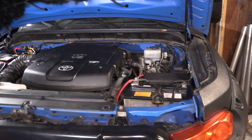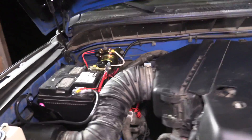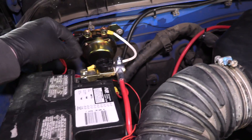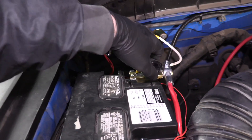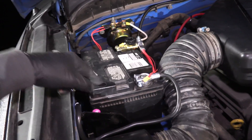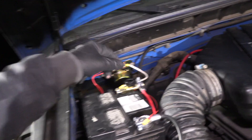I'm really stoked that didn't take very long. Here we have the positive post cable running to the other battery — it goes around and runs up with this side connection here to this post right here. Right now it's connected — both batteries are connected. If I do this, it's disconnected — this battery has no communication with that battery. It won't share power or anything like that, and it's good to go and ready to use with all the electronics.